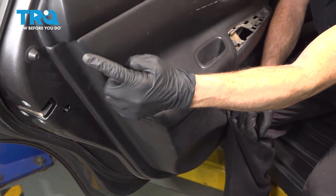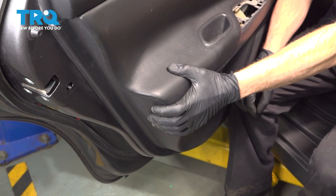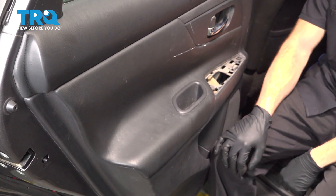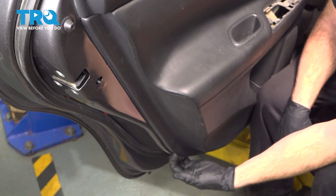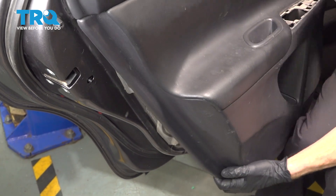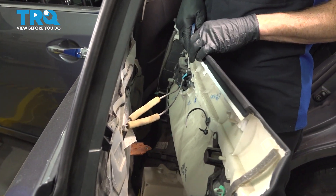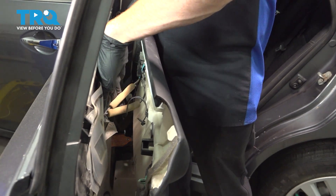At this point, we'll continue on by separating the door panel from the door itself. When doing so, you want to be extremely careful for any pinch points. We also want to pay attention to the fact that there are cables that lead along the backside to that inside door handle — whether it's the handle itself or even the lock. You can either reach your fingers in between here or use a plastic trim tool. We'll start separating this. Once you have it separated, you can start lifting it up. As we pull this away, there should be a cable tie that goes right across here — ours is broken.